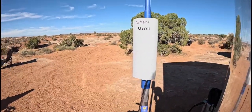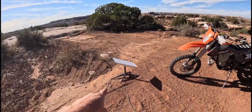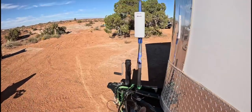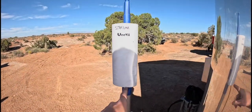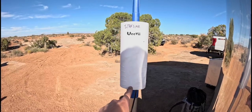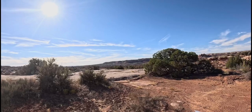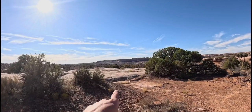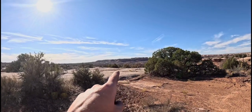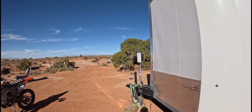So this was actually super simple to set up. You just have your internet going to this first bridge, and you put this bridge at A and then select a channel — we'll say channel 1. And then down at the swing you select B and put it on channel 1, and then you just raise them up and point them towards each other.